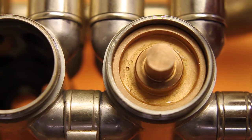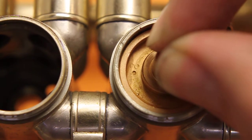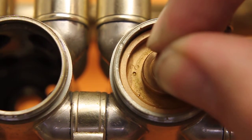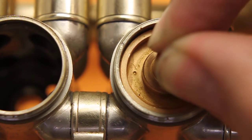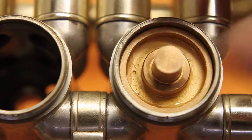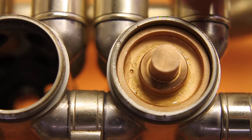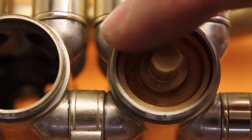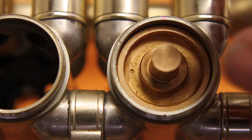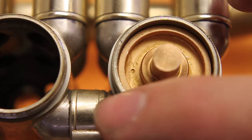Here we're going to check and see how much play we have in here — you can see there's a little bit of play going on. I've seen worse for sure, but there's enough that you're going to lose compression, as air is going to leak in between these two ports here, and in between the two ports here, even when the rotor is not depressed, you're still running the risk of having air leak into this area.